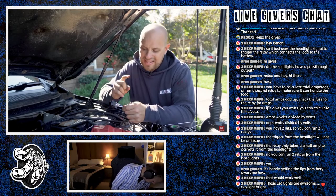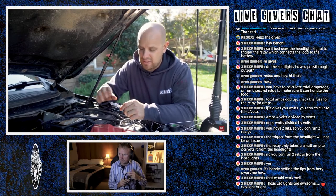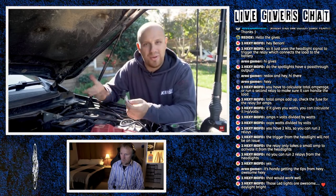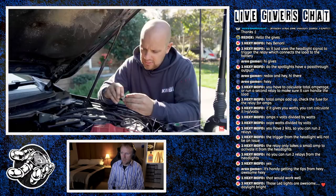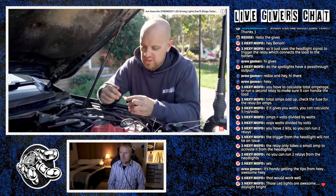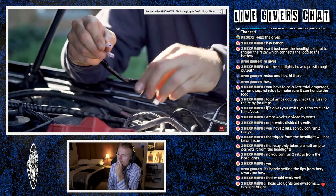We're going to take these three wires off the back of the switch. Then we're going to tape the wires to the end of that straightened-out coat hanger, and that way we've got a perfect tool to run through the grommet on the firewall. Before you do that, here's a great little trick. Take a couple of photos on your phone of how each of these three wires sit in relation to each other, and which end of the switch the LED light is on. That way when it comes time to put them back on, it's super easy to figure out which wires go to which terminals. And a word of warning: when you're wiggling these wires off the back of the terminals, don't pull them by the wire, because you can risk pulling the wire out of the connector. Grab them around the metal connector, give them a little wiggle, and take a photo first.